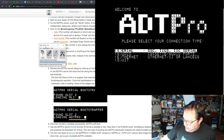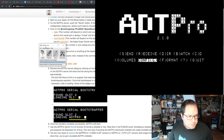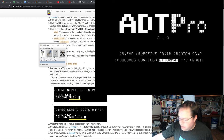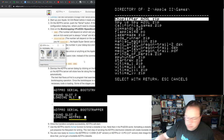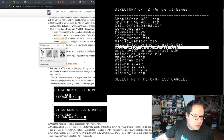Let's go ahead and load another image — let's try to load a game and make a new disc using the physical ADTPro disc we just created. It's asking us what connection type we have — serial. Now I can go back to the ADTPro software on my host machine and change my working directory to where my games are. I'll put in another disk and format it so we can get ready to write a game image. I've formatted a blank disk — we'll do the same procedure as before: hit receive, press enter when it asks for a file name. Let's do Oregon Trail.